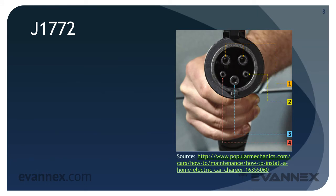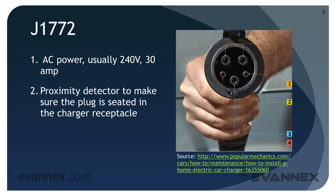Unless you own a Tesla Model S, which has its own charging connector design, your EV will likely use a J1772 charging connector if you're located in the United States. The connector shown on the right of your screen has the following layout: two prongs that provide AC power, usually 240 volt 30 amp; a proximity detector to make sure that the plug is seated in the charger receptacle; a ground; and a communications connector that enables the EV to communicate with the EVSE about the state of battery charge and other data.